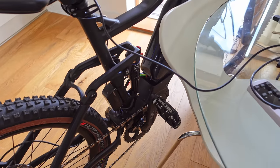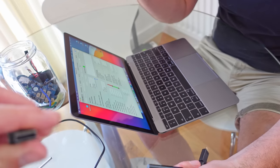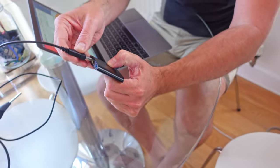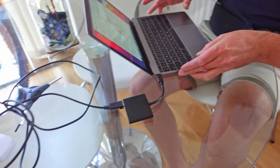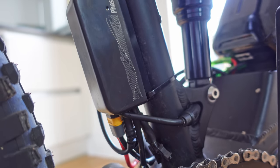So, how do you connect the phase runner to the laptop? I take it it's a USB cable. Yeah, this is the program lead for the phase runner. It's just USB A, a USB serial that breaks out into a box. Your laptop has got an audio port, but that's nothing to do with it, that's just an Apple thing. And the other end, what sort of cable goes in? It's like an audio cable, like a headphone, a little jack cable. You can make those leads, but why would you want to? Yeah, if you can't be bothered to pay whatever they charge.